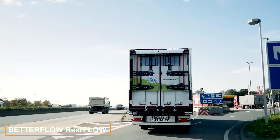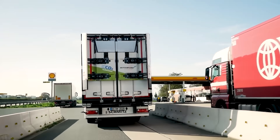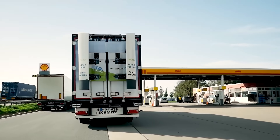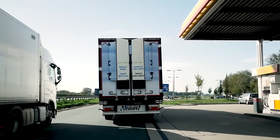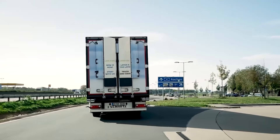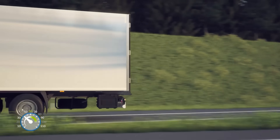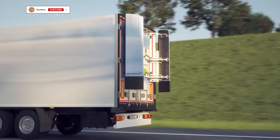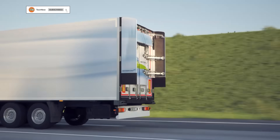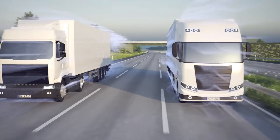The brains behind these Mercedes-Benz trucks collaborated with food giant Viyan and trailer manufacturer Schmitz Cargobull to create this truck, combining their expertise to make it as aerodynamic as possible. When the truck reaches 60 km/h, it deploys special plates that reduce turbulence, cutting down on fuel consumption. Thanks to this comprehensive package of aerodynamic tweaks, fuel usage has dropped by a solid 8–9%.